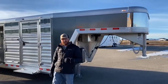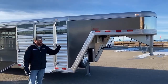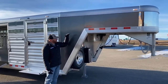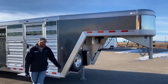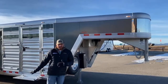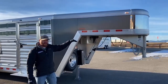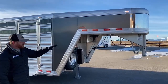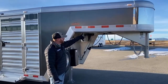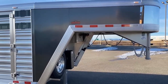The other thing I think this longer nose helps is the way these trailers pull — they pull extremely well. I know a lot of that has to do with axle placement, but I think the nose balances it out too. Also, because these new trucks are getting taller and taller, the industry standard is a 50-inch gooseneck dropwall — from here to the bottom of the floor is 50 inches. We're running into issues with newer taller trucks where we can't get the bed clearance we want and keep the trailer running level. So here at TransWest, on all of our non-living quarters Cimarrons, we've gone in and done 53 inches. Now with taller trucks I can adjust the coupler how we want, get bed clearance — I'd like to be able to touch the bed with my pinky and touch the bottom rail, or not at all — about 8 to 8.5 inches. That way you're not dinging up your bed and the trailer's running level.